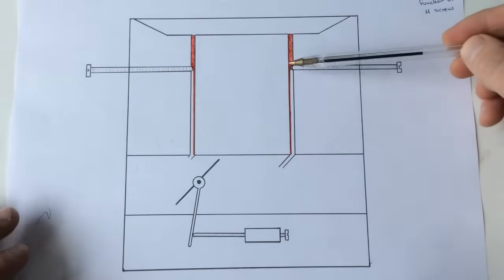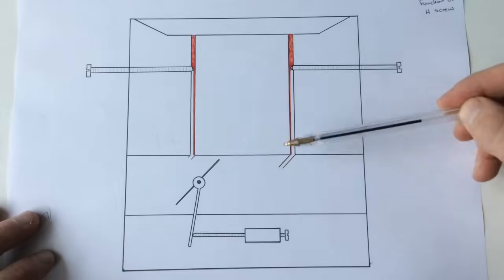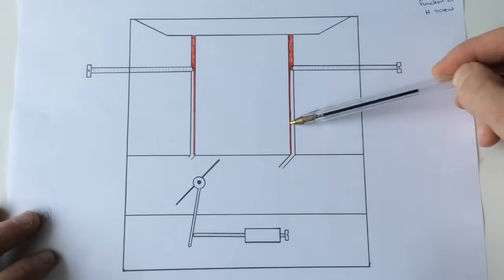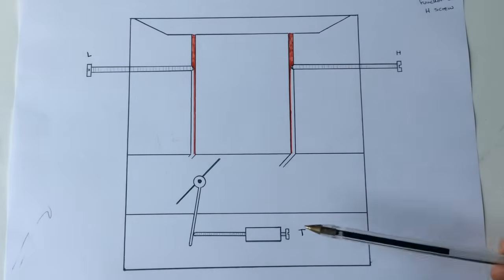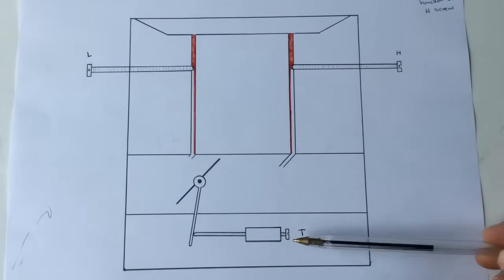The engine's not running so there won't actually be any fuel sucked down, but there is a gap there to allow some to come down once we need it. So we've set them in preparation for starting the machine. Now we just need to look at the tick over.